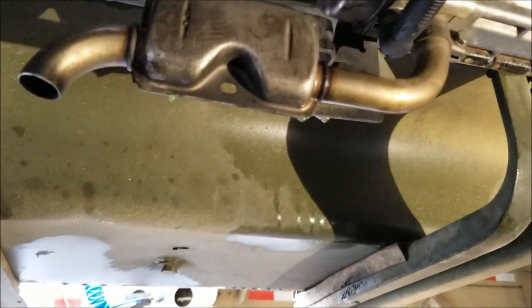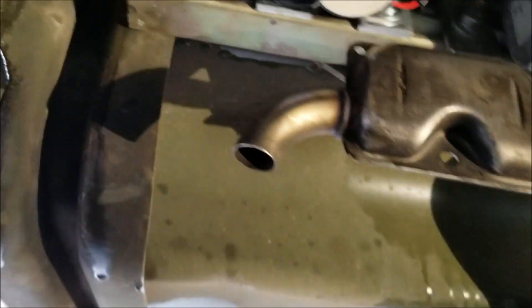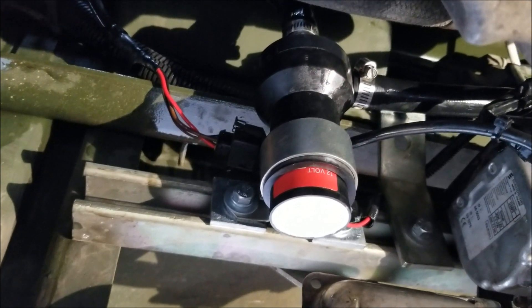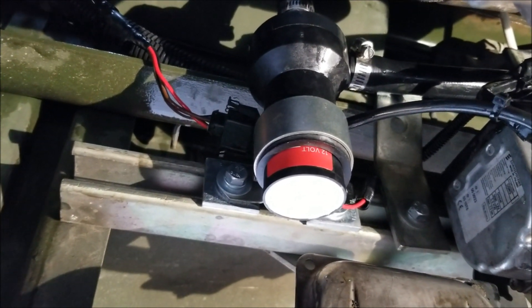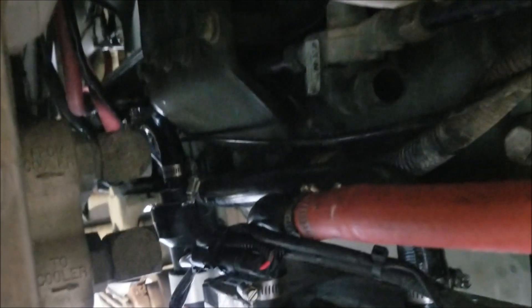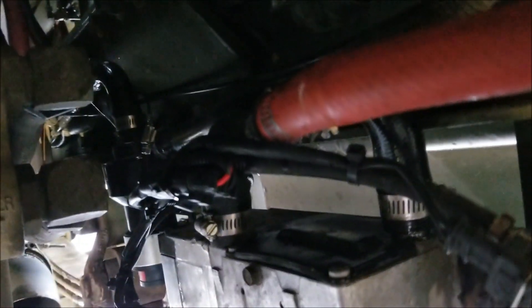All right guys, it took forever — sorry about that. But I really like this new setup and the way it's mounted. I was able to use the entire kit with the mounting bracket on the existing strut I had in there. The hose comes right in to the top where it's supposed to. That 3/4 inch pre-formed 90-degree hose comes right into the top of the Espar heater box — though it's a bit hard to see, it's kind of hidden behind the other components.